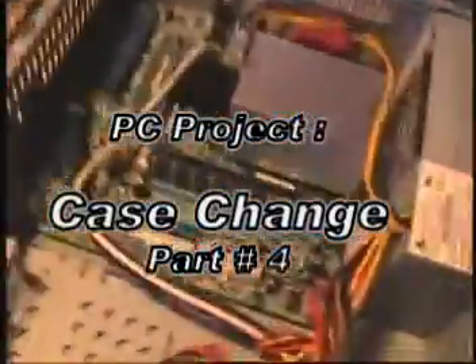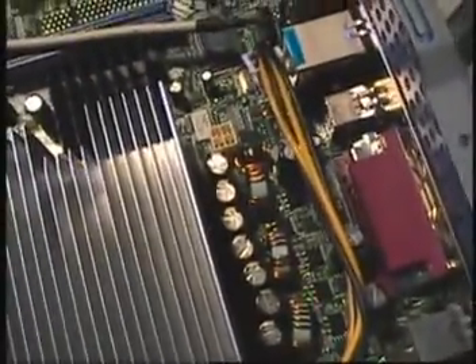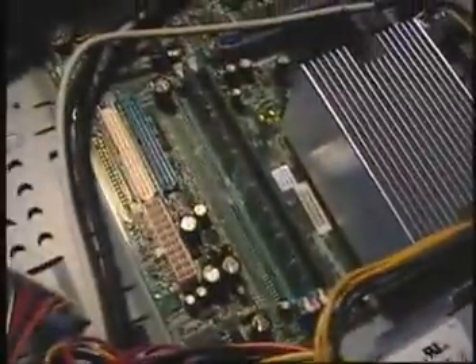At this stage of the project, not much is really hooked up to the motherboard. We still have our power button, hard drive, and power LEDs connected. Right here is the USB front jacks, and we also have the audio for the front jacks as well. By the way, the K8M800M has built-in integrated audio and built-in integrated video. So at this point I'm going to start looking for the screws, loosen them, and then transplant the rest of this board into this new machine here.